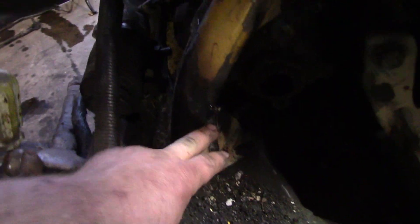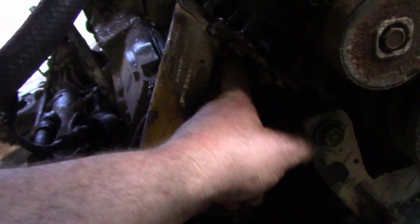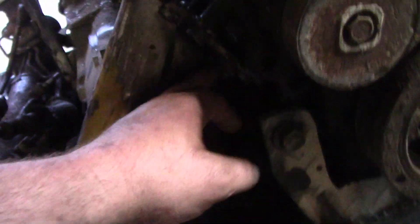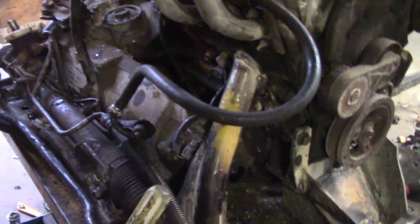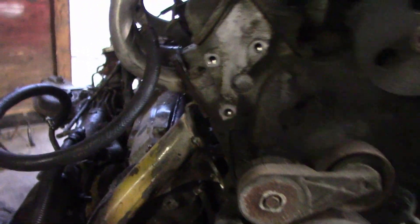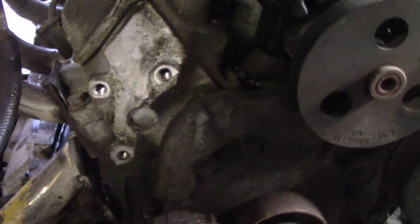With a little bit of time — as you can see it's almost dark out now — I got called away for a couple things. I have this homemade mount. I have a gusset here and a gusset here, just because everything kind of comes out cantilevered off this. See how it's cantilevered above the bolts? I wanted to be able to remove it, and then I have a gusset that comes up under the inside of all those bolts. I am a little nervous about this mount, but I couldn't really figure out a better way to do it. I didn't want to go to the heads because they're aluminum — if you put a motor mount to aluminum it's not really going to work out.